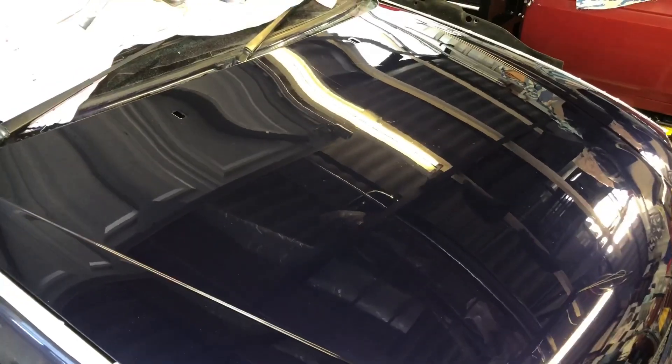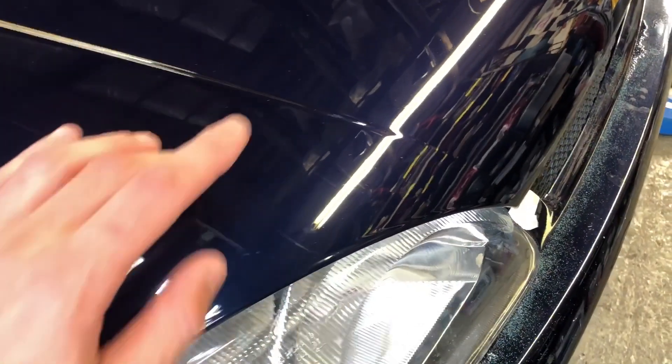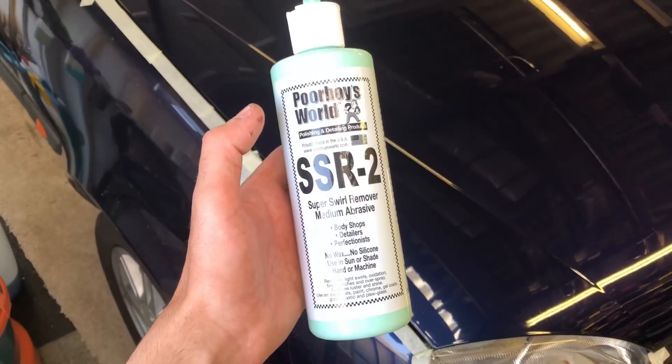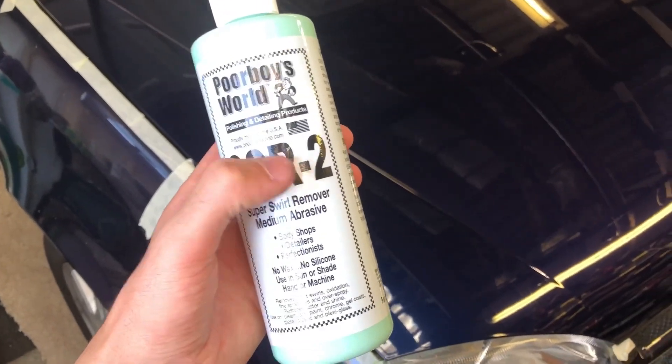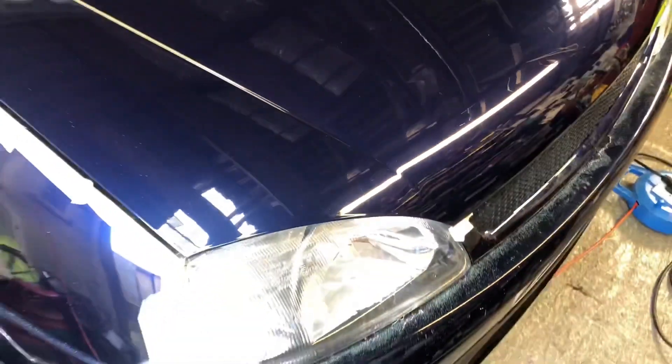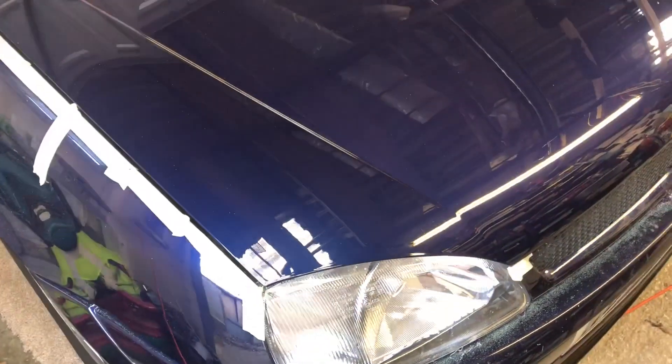Couldn't have asked for any better really. The good thing about the polisher is you can go back over stuff if you don't think it looks right. Down here I've got some specks that are just polished, and I've got one scratch there and two there — these are deeper. So I'm going to try and focus and work on this area now and see if I can get them to fade off a little bit. This Poor Boys stuff that I've got — 2.5 is the harshest you could get. So I could go and get 2.5 now and they'd probably come out pretty quick, but all I'm going to do is go back over with this maybe two more times and see what the difference is.